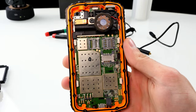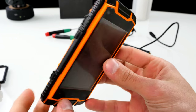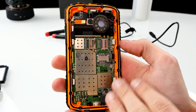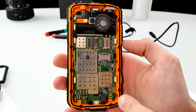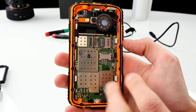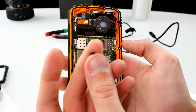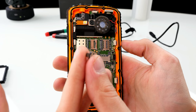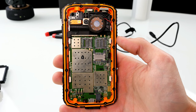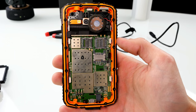This is how such an outdoor phone looks from the inside — pretty cool actually. Here you can see the display. I won't take this apart because I still want to fix this phone, and in the next part of this video I will show you how to replace a broken USB port. So we now found the issue why this phone is broken — the USB port broke down. This is a common problem with some of those outdoor phones because the USB ports are really kind of crappy. You have to always use the correct USB cable which comes with the smartphone and be careful with the port, otherwise you're going to kill it. That was a quick video here on Teardown Tuesday.